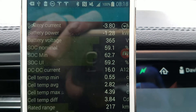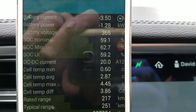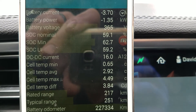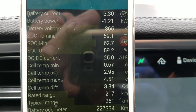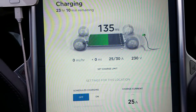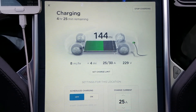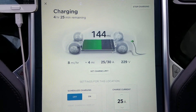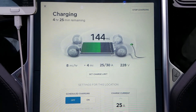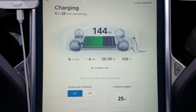The battery heater is still running but it's also adding a little bit of charge to the battery, and as the battery warms up the power going into the battery — again it's a negative value, but that means going into the battery — is going up. One important thing to mention: the battery temperature and outside ambient temperature are not the same; in many cases they're actually quite different depending on how you're driving or whether the car was parked overnight. Based on what I've been looking at the canbus data, once the battery reaches about 8 degrees Celsius that's when the battery heater stops running and then all the power can go into actually charging the battery.